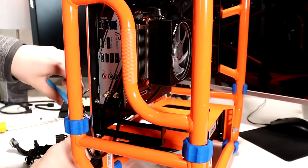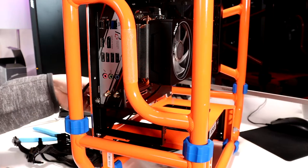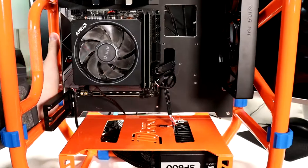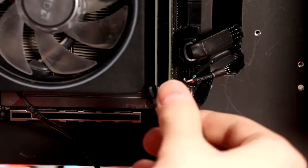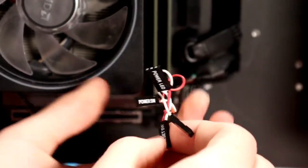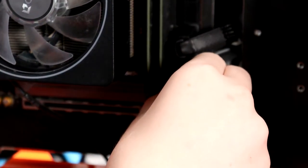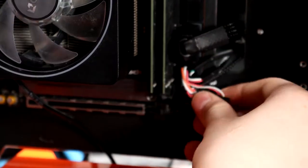There's actually a little zip tie here from the previous owner — he tied these together, but that's okay. Just unzip tie those. We got all of our little cables that we need to plug in. It's probably going to be hard for you guys to see, but we're plugging all these cables in right there. We're not going to use this power LED because we just don't really need it. We're going to use the other power LED — that's going to go right above the HDD LED. Then we have a reset switch, and last of all, our power switch. Bam, it's in there. I'm going to go grab a zip tie and zip tie this up.